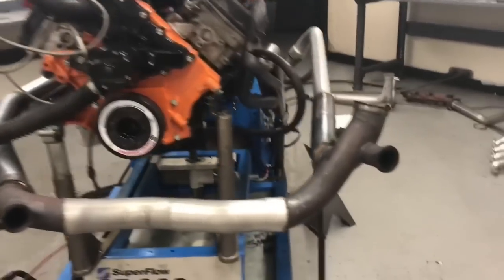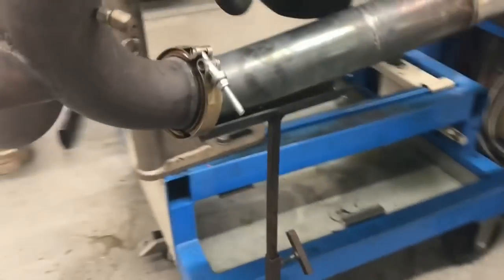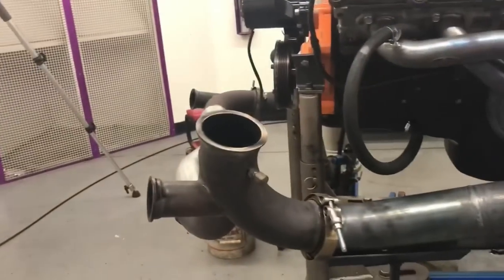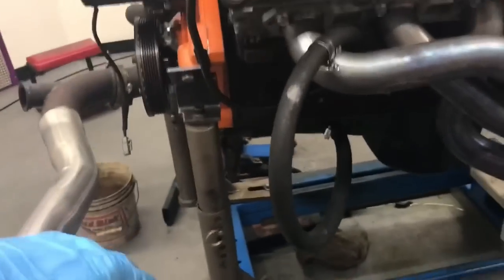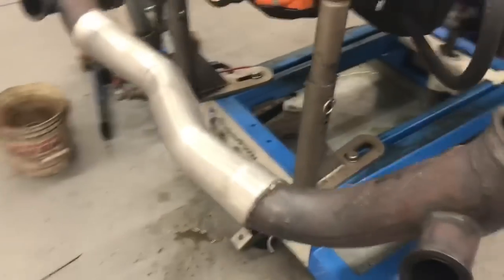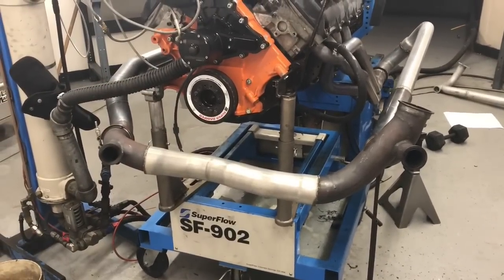Check this out. I'm going to take you for a walk over here. Get out of the way. We've got a support right here. See, under that pipe? This is where the heavy turbo is going to be, so it's going to make that exhaust sag because there's nothing supporting it from all the way back here. Normally we'd run a brace from here over to the head or something just to keep that up, but we've got this support under there that should help us. We got our Y pipe on. Let's install wastegates and a turbo.